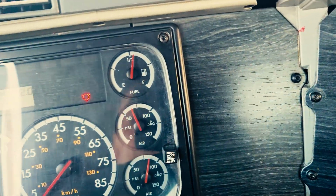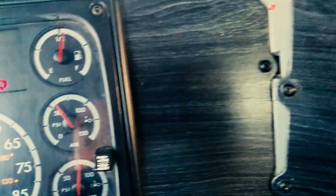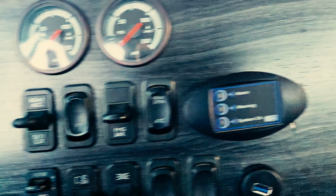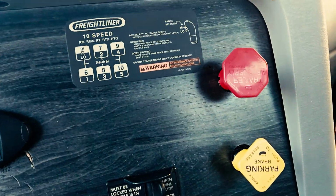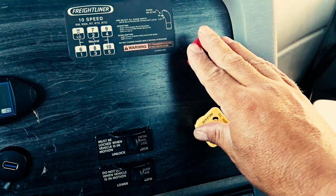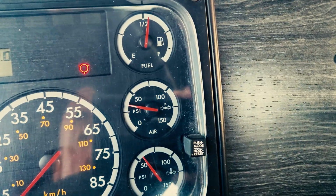Now, you are going to continue to fan your service brakes at this point. Watching your air gauges, you're going to tell the state examiner that I'm going to demonstrate that my emergency spring parking brakes function properly. When the pressure falls into the range of 45 to 20 psi, both my parking brake valves should pop out, applying my emergency spring brakes. So let's demonstrate.